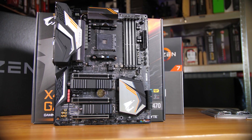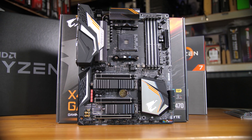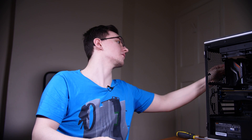Let's get to testing. I'm going to start with this X470 board first, since I haven't updated the BIOS on that one yet, and I can walk you through the process. To update the BIOS, it's pretty simple. Go to your motherboard manufacturer's website and find the page for your board. In this case, an X470 Gaming 7. Go to support, then downloads, and download the most recent version - which in Gigabyte's case is the F60C BIOS. Open the file and copy or extract the contents to a USB stick, ideally an empty one. Then plug the USB stick in, flip the power switch, boot up, and spam the delete key to get into the BIOS.